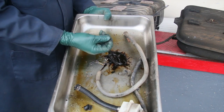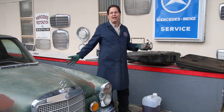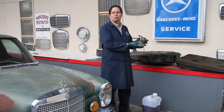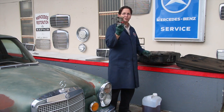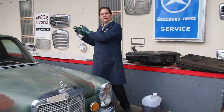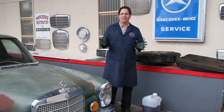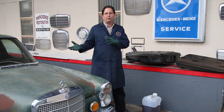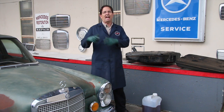Each one of those screens and check valves were gummed up. I cleaned them in brake cleaner — amazing what brake cleaner did to clean out the old gum and old fuel. I had to work outside and even wore a paint respirator when draining the tank — I'd highly recommend it, it's a really obnoxious smell. We put the pump on 12 volts and it runs smooth and quiet. So we have a good working fuel pump. The next step is to tackle the fuel lines from the back, all the way up to the fuel filter, and then from the fuel filter up to the injection pump.